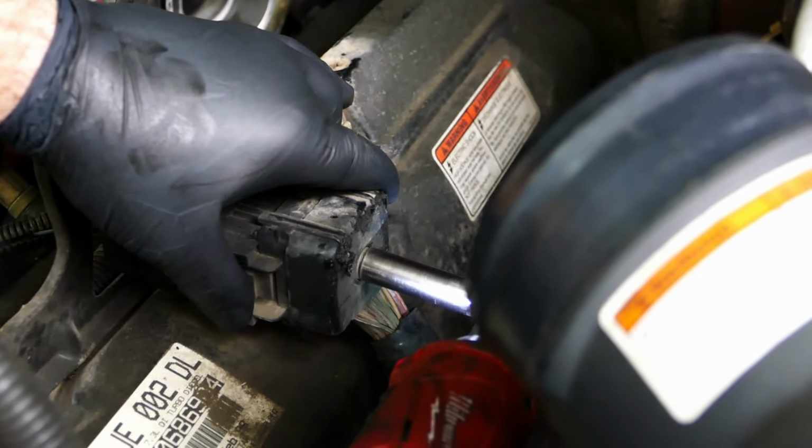And now's also a good time to unplug our under valve cover wiring harness that attaches there to the valve cover. You push in, push down, and unplug. There you go. There's that, and the only ones that are really tough to get off valve cover bolt wise are the ones that are under this PCV breather.